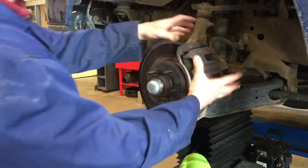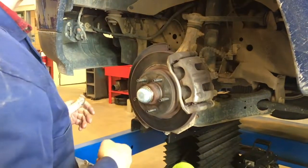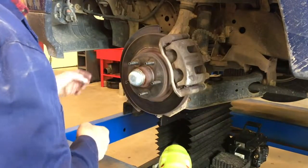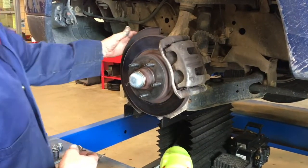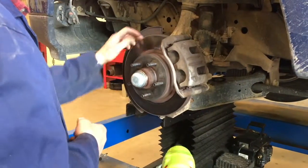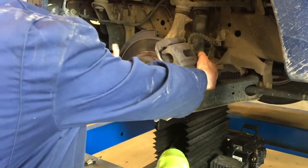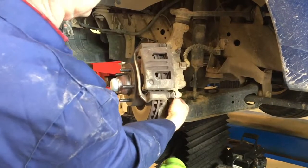To take the caliper bracket off, we're going to turn the key inside to unlock the steering wheel and allow it to rotate — not leaving the ignition on with power running to accessories, just unlocking the steering. There's a backing plate in here that when you rotate the steering, it's not uncommon for people to grab it and pull it so it bends up against the rotor and rubs later on. Be aware of that and when you're done, make sure you've got clearance around the backing plate.